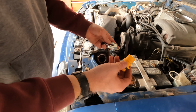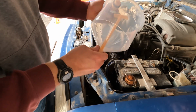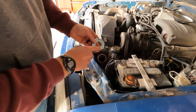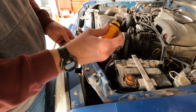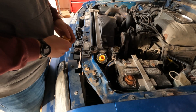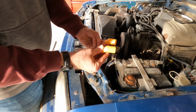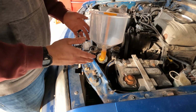The next thing we're gonna do is set up the radiator. Now, I actually bought this OEM Tools coolant funnel, and it comes with a couple attachments. I'll show you how to use this thing. For this radiator, it's an A-type cap. You're gonna take the corresponding A-type adapter, slide that in, slide on the cap. And because on this radiator, the radiator cap is actually at an angle, you're gonna use one of these 2 adapters. Now, it's not exactly straight up and down, but that's fine.